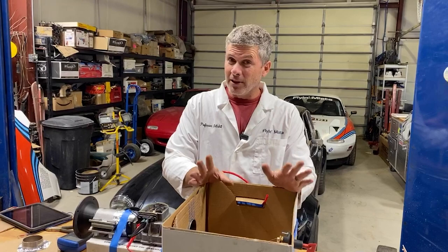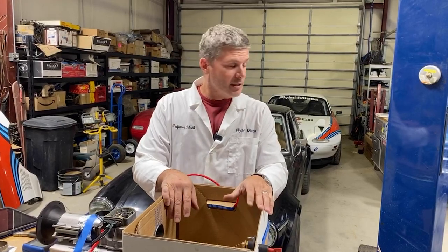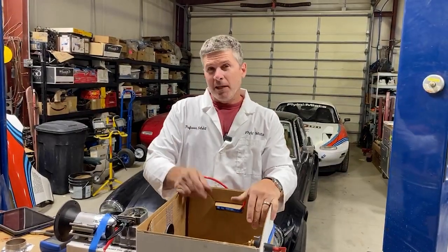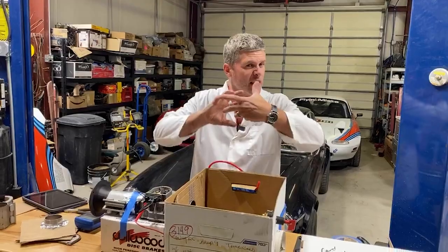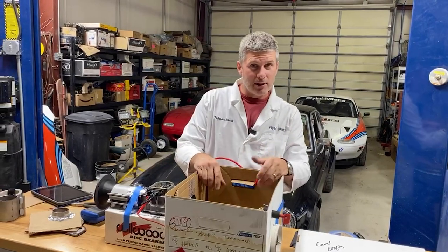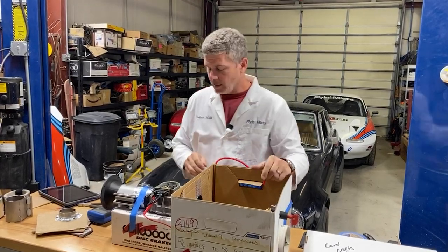Probably the most dramatic failure I've had personally was when I destroyed a carbon fiber drive shaft on the road in our V8 ND. Came out of a corner, got on it, medium hard, and the drive shaft just... I would recommend, if you are going to blow up a drive shaft, blow up a carbon fiber one, because they just kind of splinter and you're not left with big aluminum or iron rods waving around underneath your car driving at drive shaft speed. So there's my tip for the day: if you're going to break a drive shaft, break a carbon fiber one.